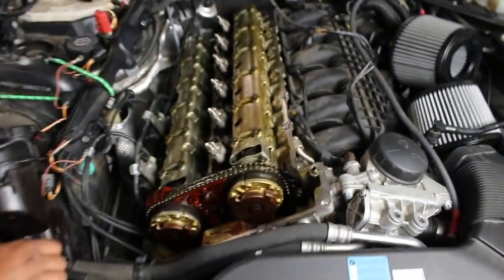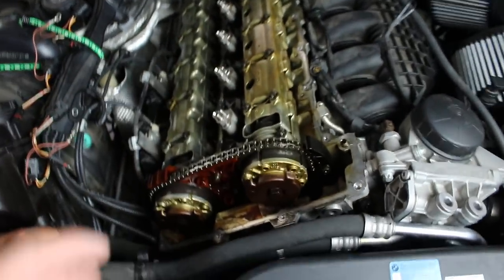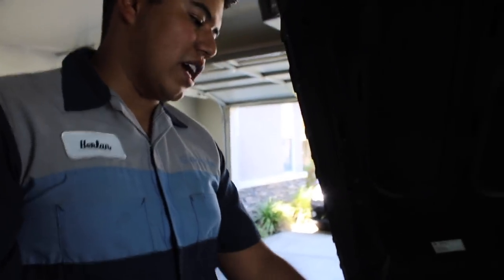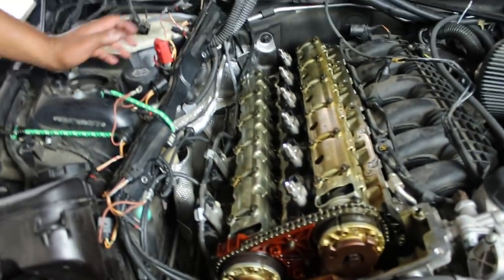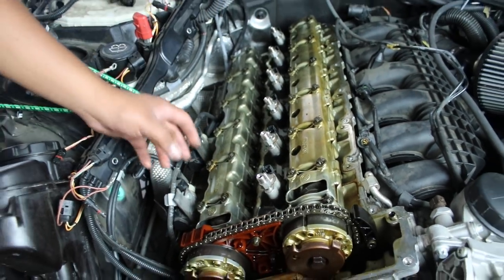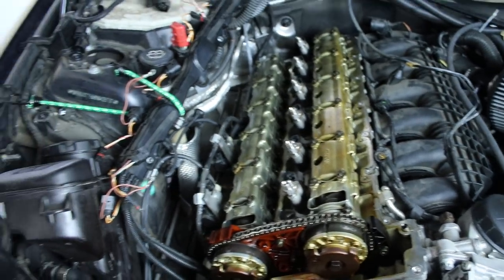I know you guys don't think I'm credible, so you're gonna be hearing from Calvin — he's done many valve covers before. This is probably his first time on an N54, but he's done a lot of the N-series, like E92s. He mentioned that the good thing about taking this valve cover off is you can see what's under there. As you can see, everything here is nice and brown. There's a little bit of build-up here, but for the most part everything looks pretty clean — probably did oil changes on time, the previous owner. Nothing's gonna be extra worn, nothing's gonna be clogged. As soon as you swap this valve cover and do the spark plugs, it should be running pretty smooth.